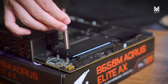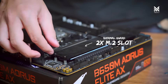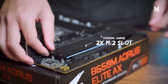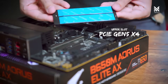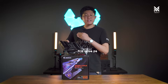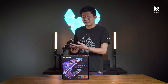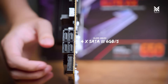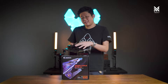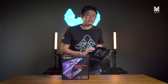On the storage side, right below the main PCIe lane, there are two M.2 slots covered by Gigabyte's thermal guard heatsink. The top slot is a PCIe Gen 5 x4 M.2 lane, perfect for upcoming PCIe Gen 5 M.2 SSDs, and the bottom slot runs on PCIe Gen 4 x4, still very good for all M.2 drives available today. Besides M.2, there are four SATA 3 slots, and the nice thing is these won't be utilizing the PCIe lanes from the other slots — meaning what you see is what you get and you can utilize all M.2 and SATA slots without conflicts.